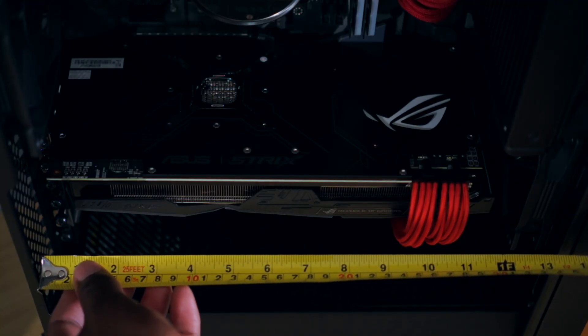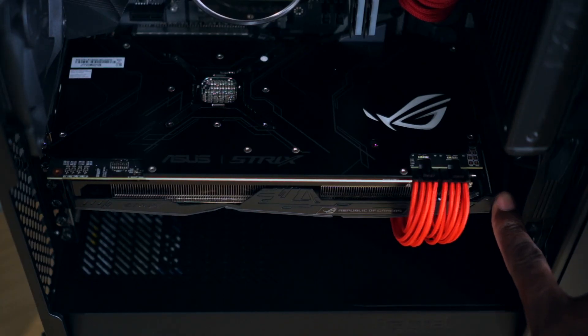This bad boy — the Corsair H110i — couldn't fit inside the case because the graphics card was massive, much bigger than I thought it would be. That's why I had to use the Kraken, because that was a single fan radiator and the two-slot one just couldn't fit. So I put the case fan below the radiator fan instead. What I initially wanted was to have the radiator placed in the front sucking in cold air through the radiator and out the exhaust fans placed up top and in the back. But because space was so limited I couldn't do that. Instead I used the NZXT and placed it up top while having a fan below bringing in air for the graphics card and other components. As a result, I probably can't overclock as high as I want to — that's why I got the K version with the unlocked multiplier.